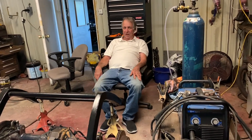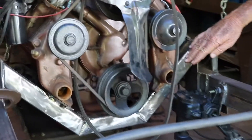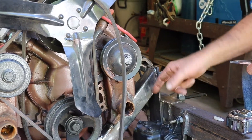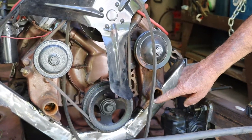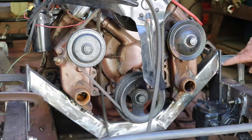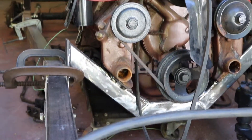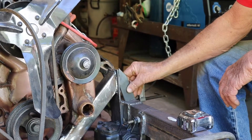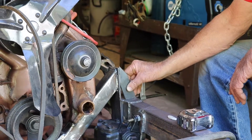A hundred and ten if they were hot motors. What we did yesterday was I built this motor mount — Ford water pumps go in like this, Ford trucks come out like this, and Mercury comes out like this and they get a tab, much easier to build a motor mount. Now with this thing, I had to cut three pieces of metal, angle it this way, and then the bottom piece that goes across I angled it, welded it all together, and we just finished welding the motor mount into the car. So now I'm going to put in a gusset here and that'll give it more support, then I'll cap it off to make it look a little better.